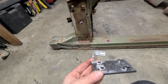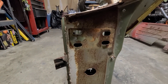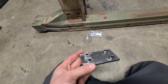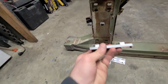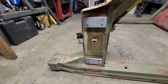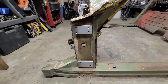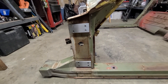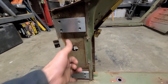I created some hinge plates here, drew them up in CAD, took some measurements of the factory bolt holes and their locations, and had these plates made — 3D printed first just to make sure they'd fit, and then CNC'd out of steel. What they do is slide into these spots for the door hinges, and they have very little play as I found with all of the bolt holes when they were stamped. There's a little bit of variation between them all, but these have just enough that they'll plug into the other sets of bolt holes — giving me a platform to start building my jig off of.